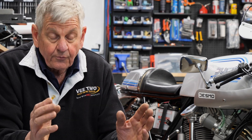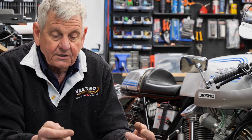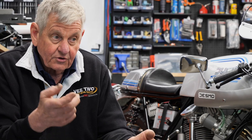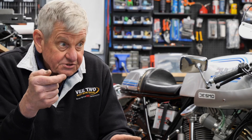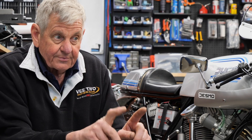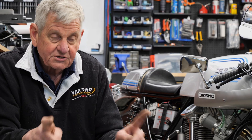You can do it on a Square Case as well. I've actually written instructions for how to do it on a Square Case, and I've got a kit that I'm going to market. There are things in that kit you could make in your own garage quite easily — like a bit of wire with a hook on it. When you've got the screw out of the bottom, you can put it down, hook it and pull it out. You can get the original pickup insert — that aluminium thing — out of a standard Square Case without splitting the cases. You'd need something that holds it secure; I've drawn that and shown how long it has to be. So the answer is you can change it on both — the Round Case is easy, the Square Case is a little more difficult but 100% possible.